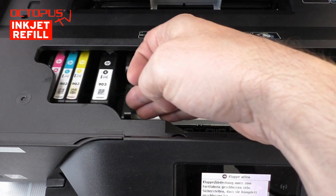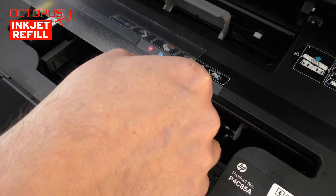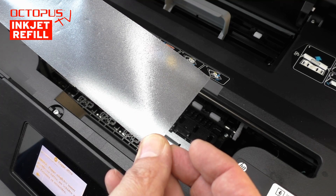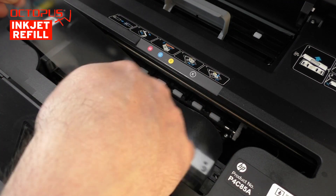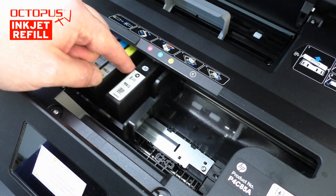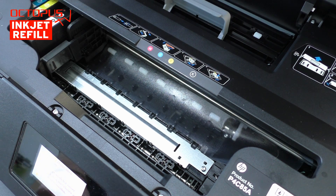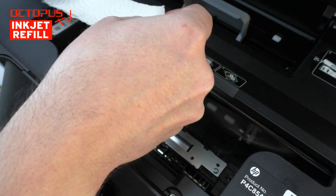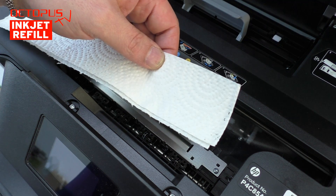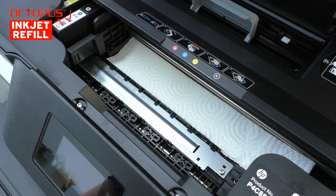We moved the print compartment to the left side to be able to bring in the absorbent underlay. Out of our foil material we have cut a stripe approximately 5 cm wide and 30 cm long — this way it fits better into the working area inside the printer. We position this piece of foil in the middle of the working area. The purpose of the foil material is to prevent the mix of cleaner fluid and ink coming out of the print head nozzles from leaking through the absorbent paper material further into the printer. The second layer of protection is the absorbent paper material. The advantage of cut stripes is that multiple layers laid above each other are thinner than layers folded above each other.